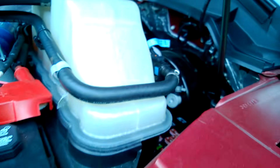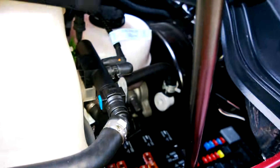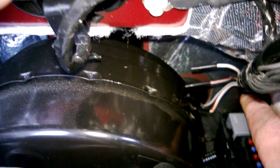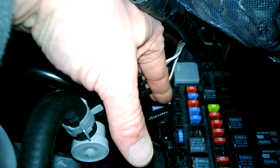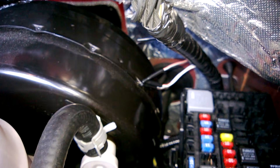Now, outside the truck in the compartment, behind the fuse panel — which is located right behind the reservoir next to the brake booster — there are two little tabs. If you push on these tabs, you'll lift the cover off. Down, buried behind it, these wires are looped down and taped off. You just have to grab the wires and pull on them; I couldn't get anything back there to cut them until I got them pulled up some. You will find your black-white, gray-red, white-red, and white wires that come through the firewall and match up with those wires inside. So if you want to tie in to bring power out through the firewall into the engine compartment, you can get to them there. Otherwise, you can just use the direct wires up inside the compartment.